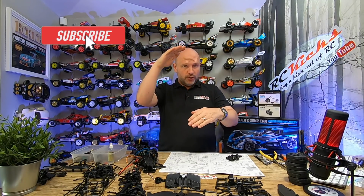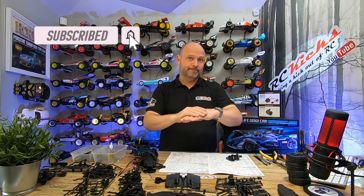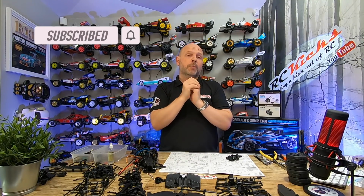So the mistake I made is I put two 0.1s in the bottom, which means I was only out by 0.1 of a mil. So when I built the diff, it felt totally fine. The problem came when I built the second diff. I was then left with two 0.3s, giving me a 0.6, and it should be a 0.4. So that's 0.2 mil difference. And when I built the diff, it was very tight.